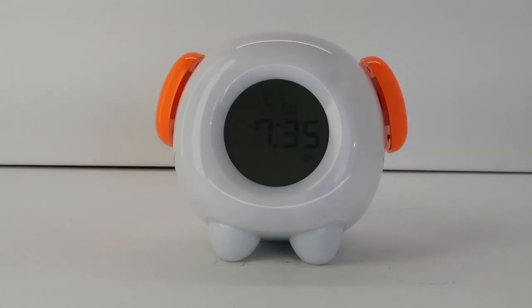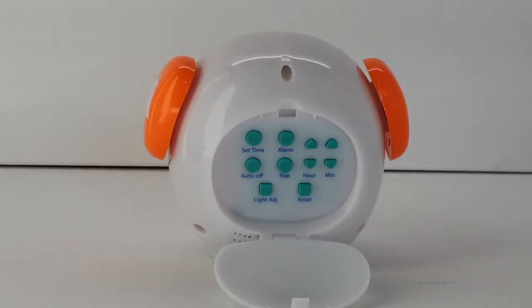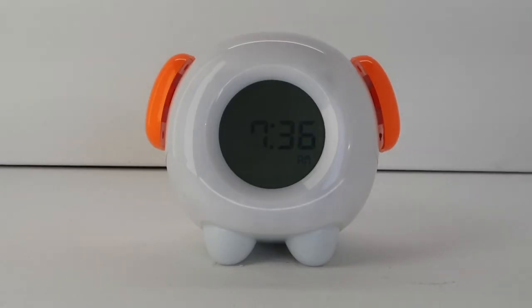Turning off the alarm settings. The OK to come out of bed and the stay in bed light alarm can both be turned off completely so there is no alarm. Or the stay in bed light alarm can be turned off leaving the OK to come out of bed alarm still active. To turn off all alarm settings, open the cover to the control panel and press the alarm button. The light bulb and the bell icon and the alarm time at the top of the display will disappear, and the current time will be shown in the middle of the display.